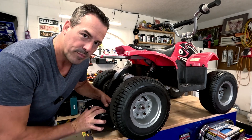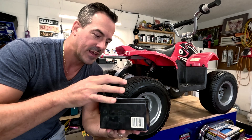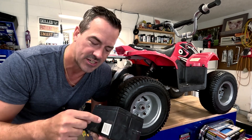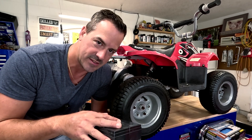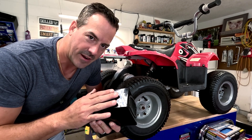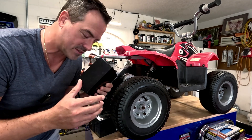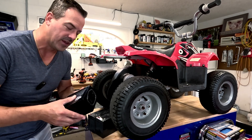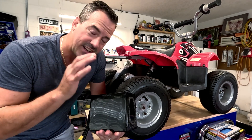When you're talking about replacing batteries, you could replace these lead acid batteries for about 50 bucks. This would have about five amp hours of capacity. Now these are 10 amp hour batteries, but you can only use about half of them before you start damaging them. When it comes to lithium, you can use a hundred percent of the battery. This is 20 amp hours, so that means this is four times the capacity — and it's actually a little bit smaller. This is going to cost you about a hundred and fifty bucks.